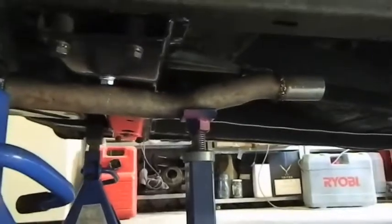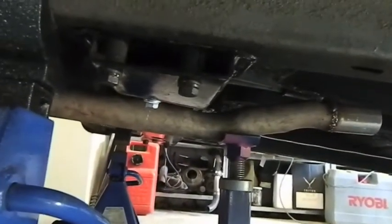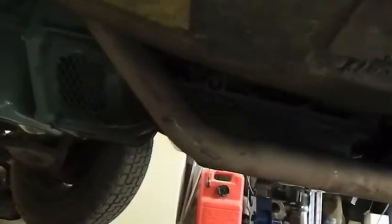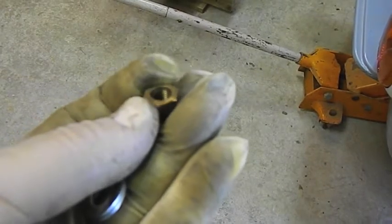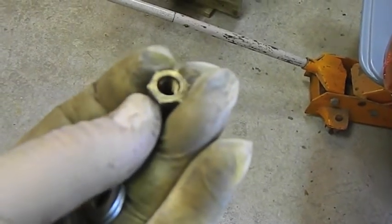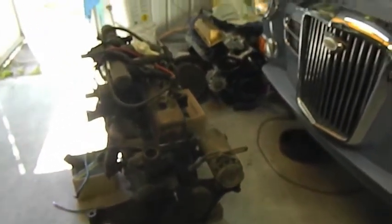And I've just got the bottom sitting on a jack stand. So I'll put a bit of sealer on there and start nipping it up at the engine pipe, and then I can put a bell housing bracket on as well. Make sure you use the brass nuts. They're less inclined to gall on the threads, because they get very hot, than the mild steel ones do. Getting a little bit harder to negotiate room here. I'm going to have to move this 14 motor.